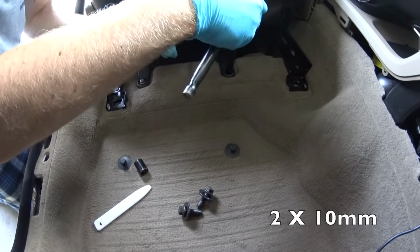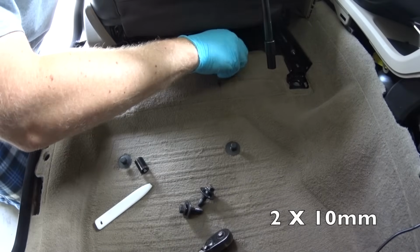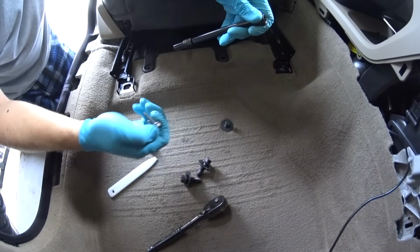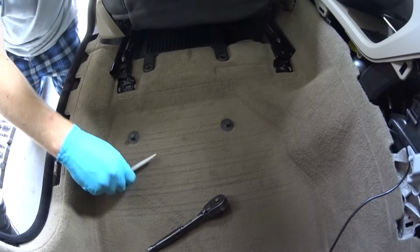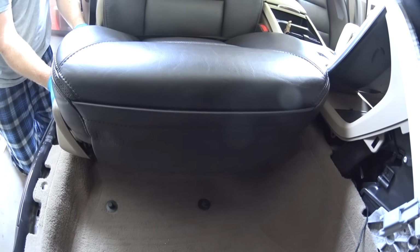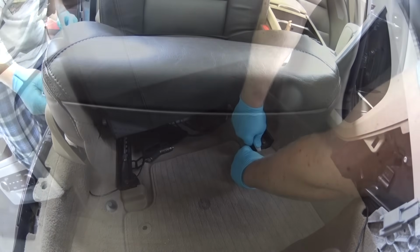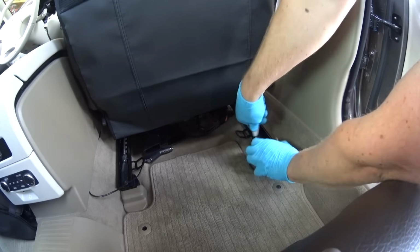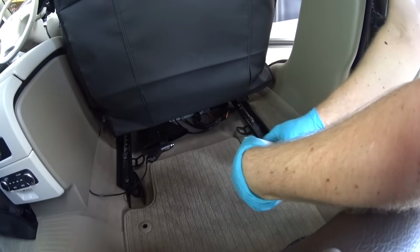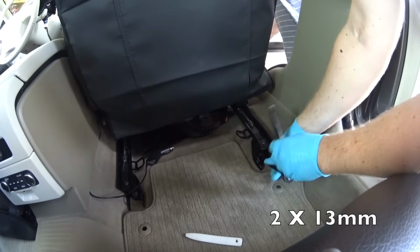Next, under the seat you have the audio amplifier. It's held by 3 bolts 10mm. We have access now for the 2 bolts. The 3rd bolt we will gain access to a little bit later. We had to reconnect the battery to move the seat forward to gain access to the 2 other bolts at the back. Also use the bone tool to remove those decorative covers. Just pull on them, they're gonna detach. Unscrew both of the bolts and your seat is pretty much undone.